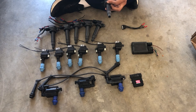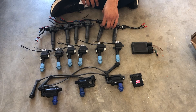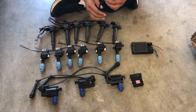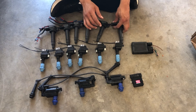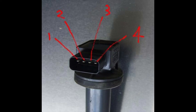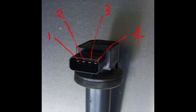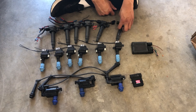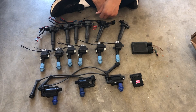Since these are Toyota coils you can source them directly from Toyota. I picked mine up online for about $25–$30 each, and the pigtails were another $14 each. That gives you individual cylinder control without any external igniter components that could fail — you can just swap a coil and go. The wiring is simple, but be very careful: if you cross power and ground you'll burn out the coil and have to replace it, so get the wiring right.